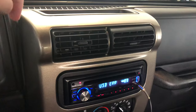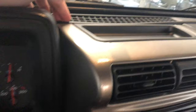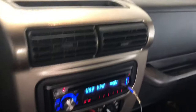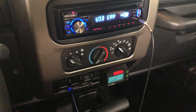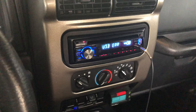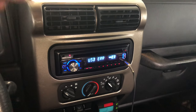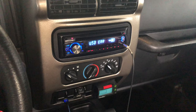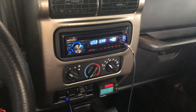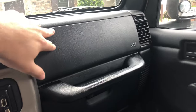Number one is the bezel — I painted that the stock color of my Jeep. You can pick up these paints at Quadratec depending on what color Jeep you have. You just pop out this plastic piece, there are a couple of screws, and the whole piece comes off. I cleaned it really well with a brush and dish liquid — you need a degreaser to remove any oils so that paint will stick to it. I also used an adhesion promoter when painting plastic. After painting, I gave it four or five coats and then went back over it with about three coats of clear coat.